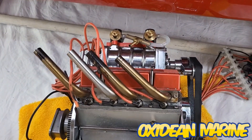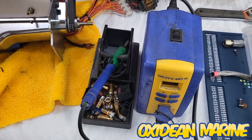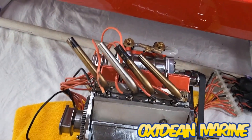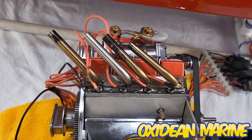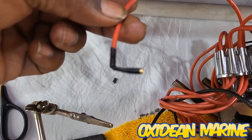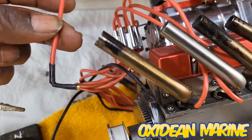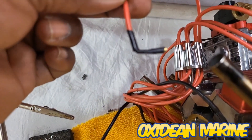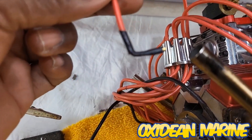That's just not the way I go about things. So I've got my soldering iron here and I'm gonna re-solder all the plug wires, go around and do them one by one so I don't mess up the firing order. That just looks bad — not reliable, not the way I want to run this motor. When you're gonna hit the water, man, I'm gonna do this right and take my time.